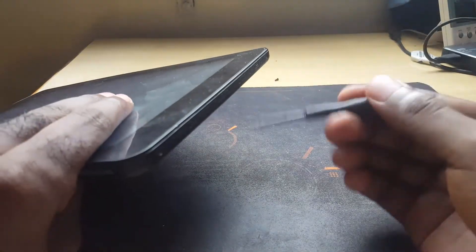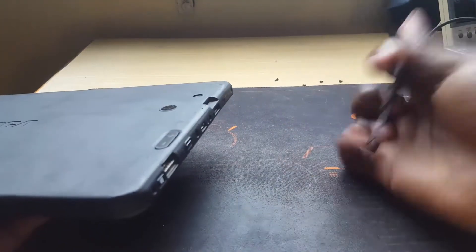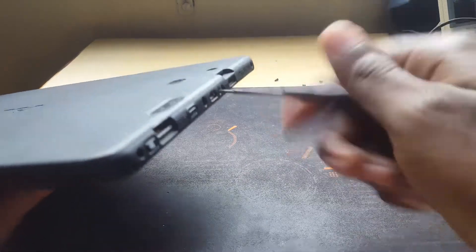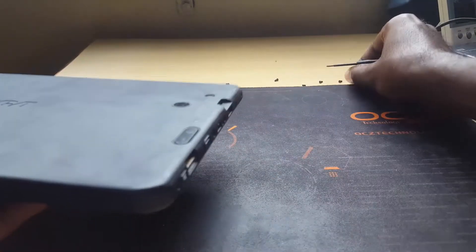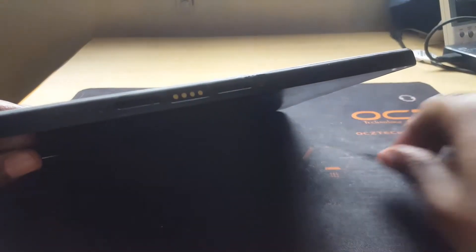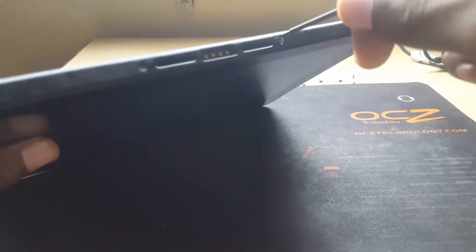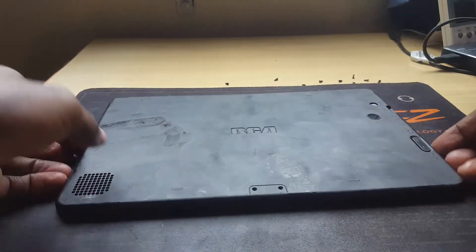We'll look at the sides — there are two screws on this side. Also make sure you get a padded surface; it helps and prevents the tablet from getting scratched. Make sure you don't miss the center one right here — it's actually three on that section, I almost missed that. On the lower side we have two just beside the charge port. In total there are nine screws, so search carefully for them. Note that not all devices have screws — some devices have both halves snapped together.